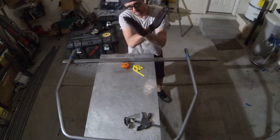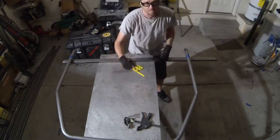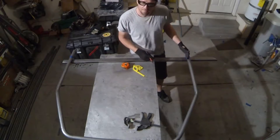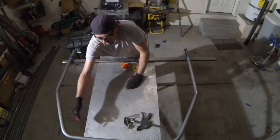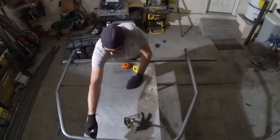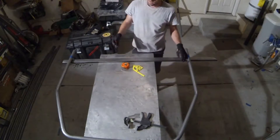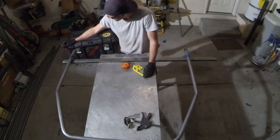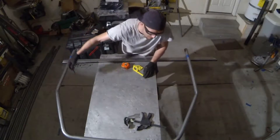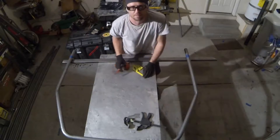So what we're going to do is form the X brace. The X brace is going to start with our main brace — since this is right-hand drive, it's going to go from the bottom left of the car to the top right of the car. It states that it has to be within 12 inches, but we're not going to go anywhere near that. So the second brace is going to go — and this is going to be cut in half — from the bottom right of the datum point, up to the same point, just past the bend, on the left side.